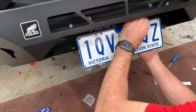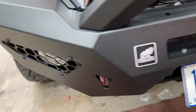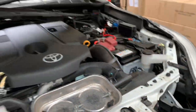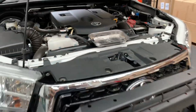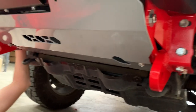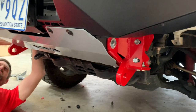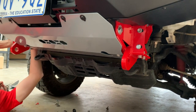Let's finish off. Don't forget to put your front number plate on the flip. Don't forget to put your logo there. There's one extra bolt underneath in the back of the panel. We'll put this back on here, then close the bonnet and we'll be finished. We do need to put on the compliance plate — I generally put it well underneath out of harm's way so you don't have to see it, but if a cop wants to see it to confirm it's compliant, you can show them.